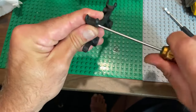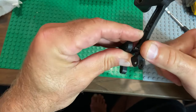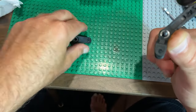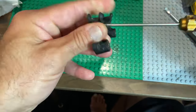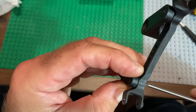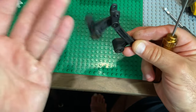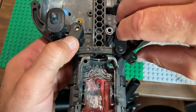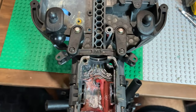I did try two shims on each side — and once I hand-tightened and cranked them tight, they bound and stuck. So there's a little lip there, and one shim just seems to be perfect. These are my findings, and I'm happy with the outcome. Some guys on the Facebook groups or Arrma forums are using different combinations, but for me, after about four or five different combinations, this is what I settled on. That's about it for that portion — put the bell crank back in and ensure it's moving freely.